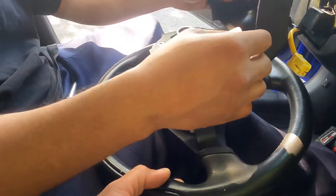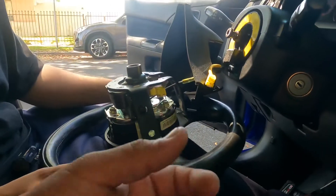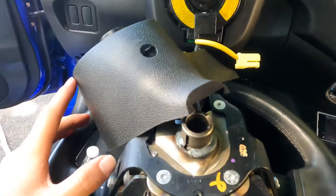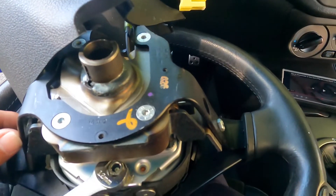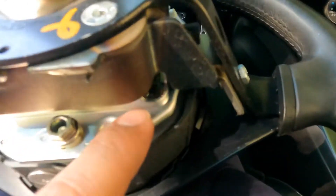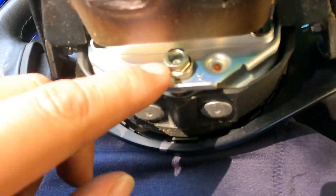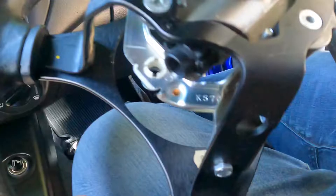You're probably just going to have to set this aside until you're able to access that screw. You can see it better now — it's that screw right there. Once you have the plastic removed, try an 11. Once you remove this plastic piece, I'm going to remove the airbag to gain access. It's three bolts — one, two, and the third one's right there. Looks like it's a 10 wrench.